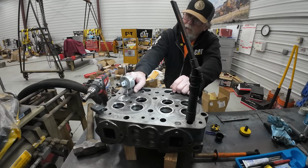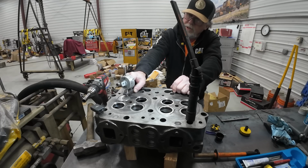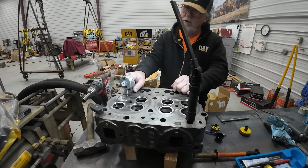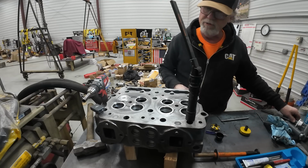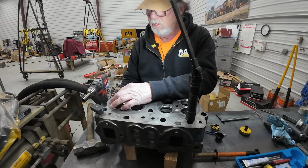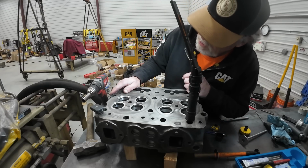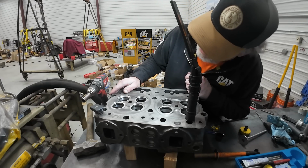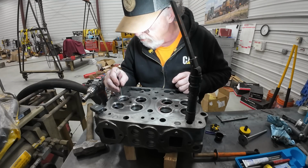the less silicon carbide, the better. So I'm clear down to 15 now. So that was another 10 thousandths off. So if I can get another 10, that leaves me down to 5 is all I've got left to do. So at this point, I need to slow down a little bit and stop being so aggressive.